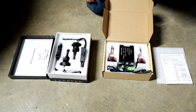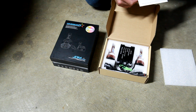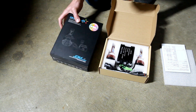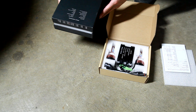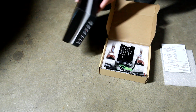We're going to go ahead and plug both these bulbs in and compare the brightness, color, and how well they work. As far as the specs go, this LED is a 4000K color temperature and a 40-watt rating on the power. The JDM is a 6500K color temperature, so it should be brighter or more white, and it's rated at 25 watts of input power.